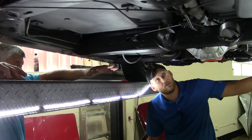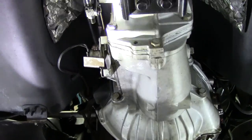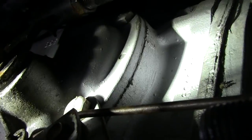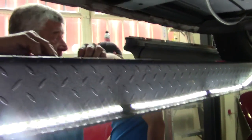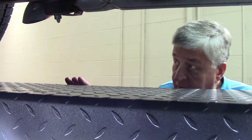While you're underneath the car, could you show the stamping on the transmission and point that out? If you look right up in this area where the light is, you'll see the stamping. That is going to be the year model and also the last six digits of the VIN number, and this number matches the car's VIN number — so that states that this transmission is matching numbers. Years ago in the 70s when these cars were about 10 years old, matching numbers wasn't even talked about. It wasn't uncommon to just swap a transmission out. So it's nice to see that the original transmission survived with this car.